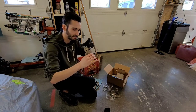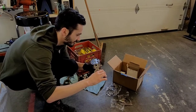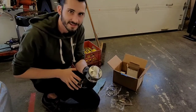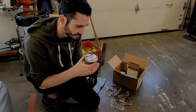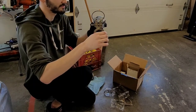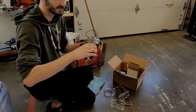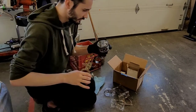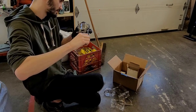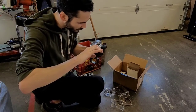You want to be very gentle with this process. You don't want to wind up making the gap bigger and you don't want to break your rings. Open it just enough to get over. There we go - kind of nerve-wracking because if I break these I don't want to have to order more. Now that that one's on, go to the top one. For now it doesn't matter which way the opening is because we're going to spin it around and put them in the specific way before it actually goes into the block.